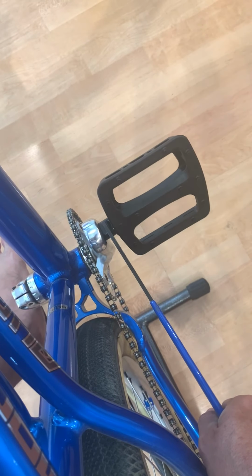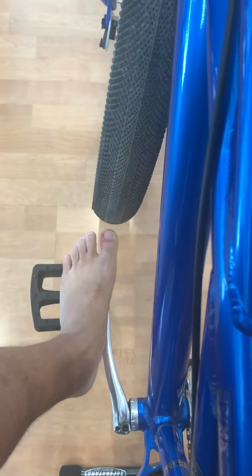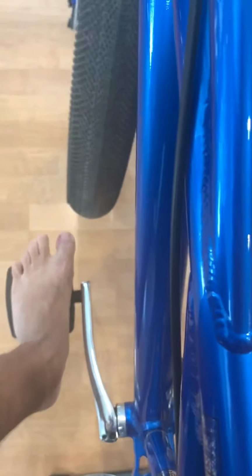So when you're tightening these, you want them on tight, but you don't want them on so tight that you can't remove them. So basically I put my foot on one side, and then I've got this, and I lift from the back, and that's about it. Feels like it's about 20-25 foot-pounds of torque, if I was to guess. So now we've got our bigger pedals on. Because they're spaced out a little wider, I've got a little bit more clearance here for my toes and the front of my shoes. So that's the reason I went to these wide platforms on the Monster Quad.